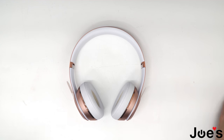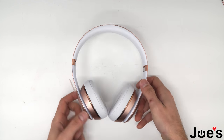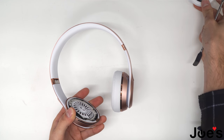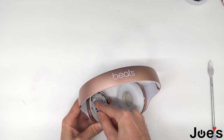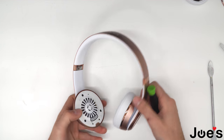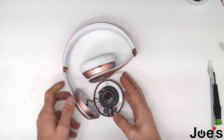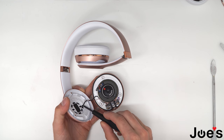The issue here would be this little wire that will need to be replaced inside your headphones. This wire is located on the left side of your headphones. First thing you want to do is remove this ear pad with the pry tool just like that. Remove any tape that's left over. So once we remove all that tape, we can go ahead and unscrew these three screws with a Phillips screwdriver. Now we can just pop this speaker up, and under here you can see where the wire is — it's this black one here running along right here.